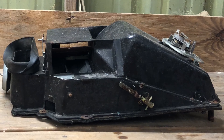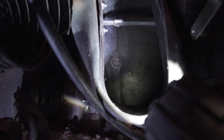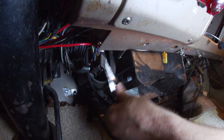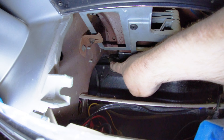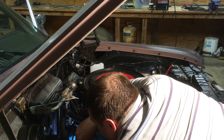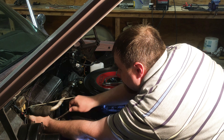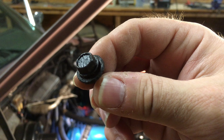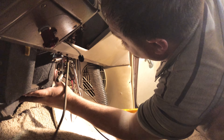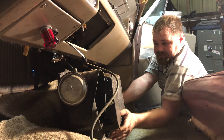Here's a preview of what we're about to remove. There's a fastener at the bottom left that will come out, and then there's a hidden fastener within the heater box itself — if you miss this one, you'll be breaking some fiberglass. Way in the back, there's another bolt that will need some extensions to remove. The majority of the bolts on the right side will go from the engine compartment into the passenger compartment, so you'll need to go under the hood to remove them. One easy way to tell a heater box bolt is a smaller washer on it. There's a single bolt on the right-hand side in the passenger compartment, and after removing it, the box can be rocked out of the way.